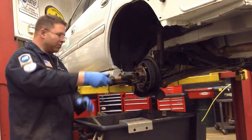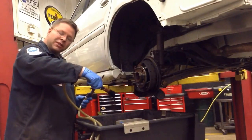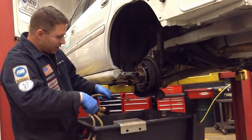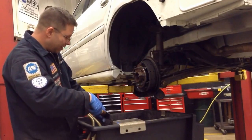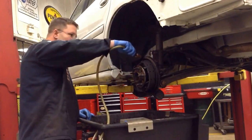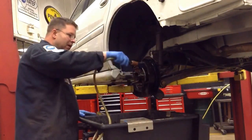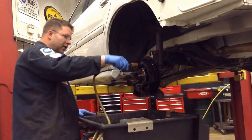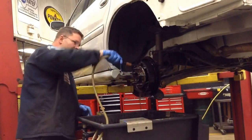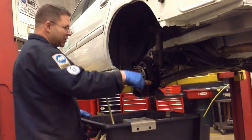Then we go ahead and rinse off the rear brakes. This has two features: it has a brush to let you get in there and brush out any of the dust or material, and it also has another hose with a little bit more power to it. I kind of prefer the brush, so go ahead and clean those shoes all up. Make sure you get in there on the hardware — it never hurts to get the backing plate as well. What this does is get any dust out of there that could be causing a brake squeal.